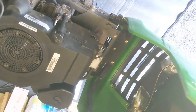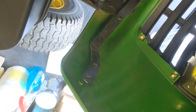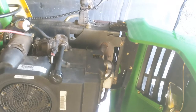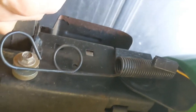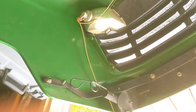We've got a John Deere L110 and I'm going to try and fix this hood — as you can see it's broken off. First let's take the hood off. Pretty basic: pull these springs back off their keepers. Make sure you unplug the light connection — just pull apart. Same thing on the other side. Get the springs off and then you get the hood off. Pretty simple — you just bring it down to 45 degrees and pull it off.